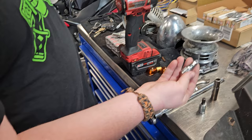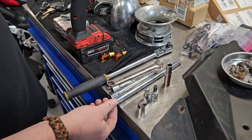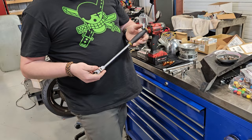I use the swivel extensions, but sometimes just having the actual U-joint kind is the best. I'll borrow that because it'll probably become a point where I'll fight with it. I grab all the extensions because you never know which one you need. I have to build my sockets into the side of the cylinder. The V12 I had was that way — you had to feed the socket in, then the extension, then the wrench, make it all together and click into place while your arm is crammed underneath the intake.